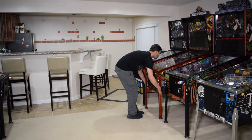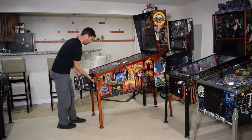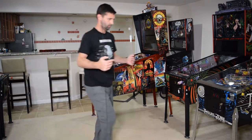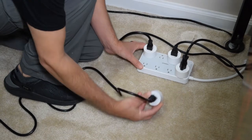To begin this installation, move your pinball machine so you have access to both sides of the cabinet, then open the coin door, remove the lockdown bar, and remove the playfield glass. Before beginning any work, be sure to unplug the pinball machine.